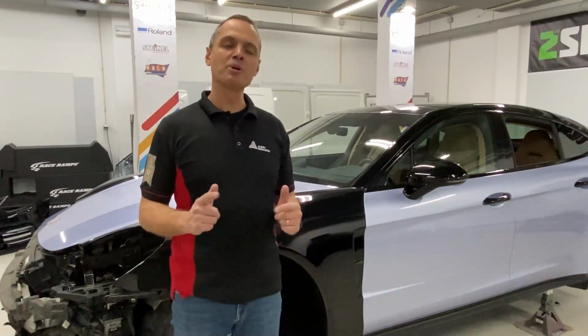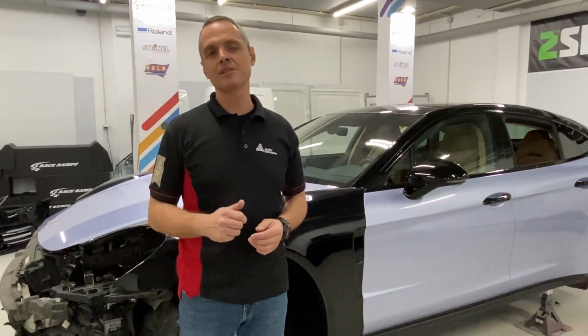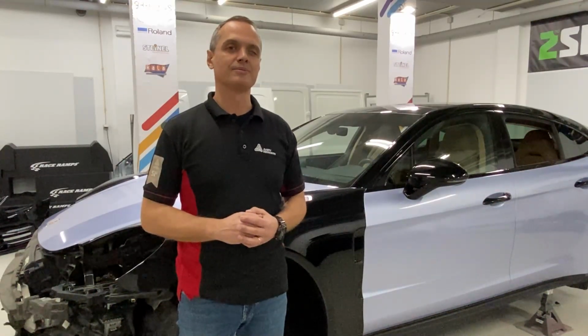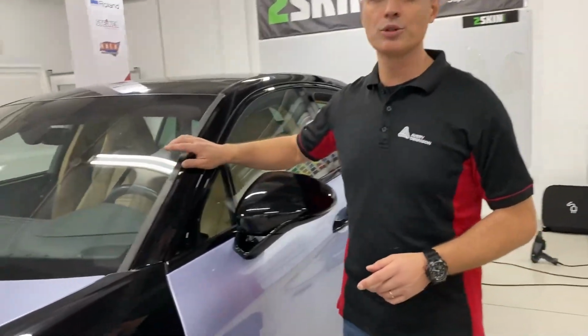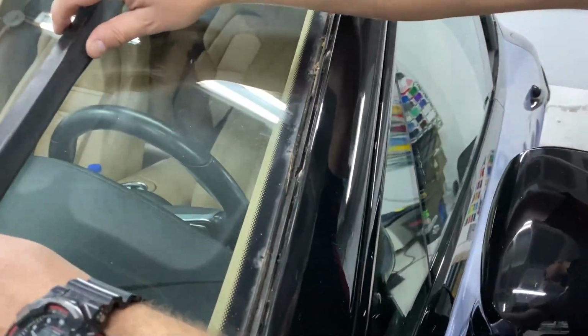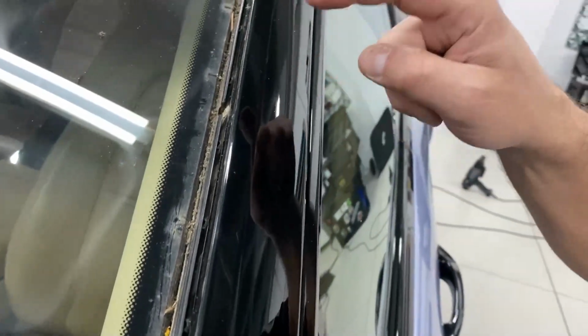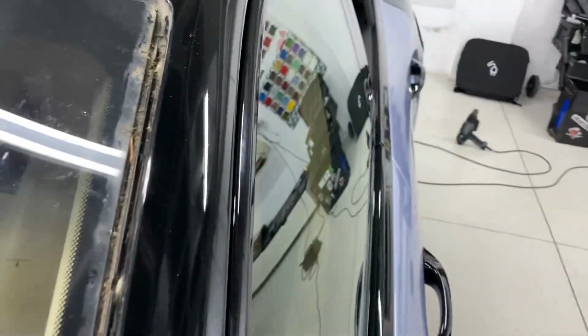Today I will share one of the most important topics in car wrapping, which is the cleaning and preparation of the vehicle. One of the first things to do is to remove all possible elements from the vehicle for a correct application, such as this windshield cover. After removal you'll see a lot of dirt accumulation here. All this dirt will be very detrimental to a good finish. First step, vacuum the dirt and then use the cleaning product such as Avery Surface Cleaner.